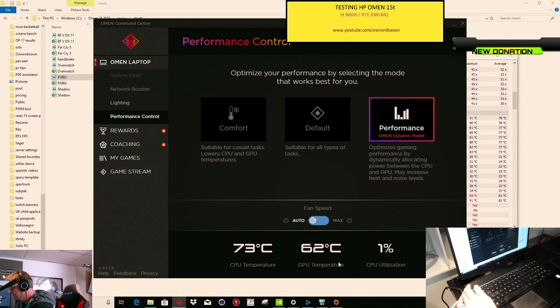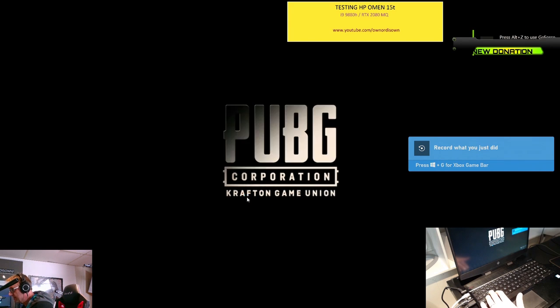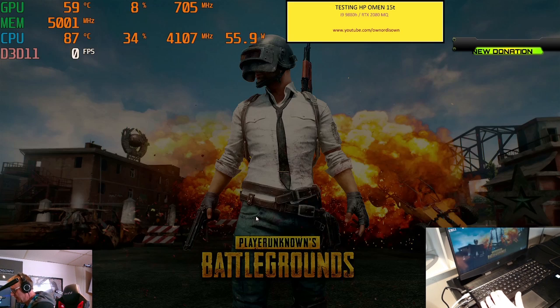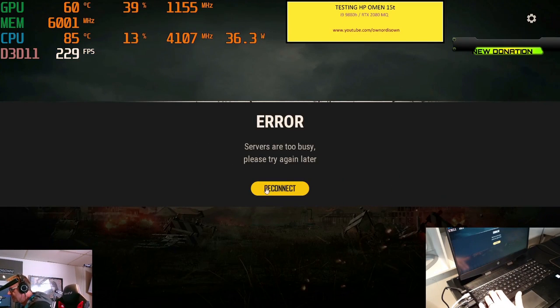But we're still on this auto fan. So I'm sure the 2060 and the i7 will perform just as well. Now, I have had people email me saying that theirs is running 98 degrees and so forth. Mine certainly, with the initial Command Center, was running 80 watts, and it was just too much to cool, really. I wish I'd had more time to play around with undervolting at the time, because it did the update and then it got solved. Now I do plan to go back to the previous version.